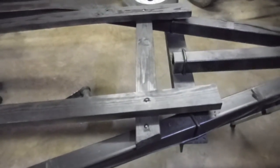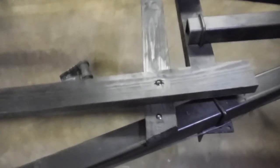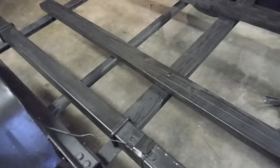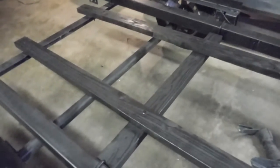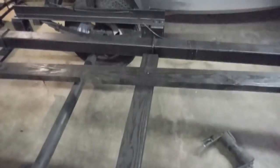What we done is I put a cross board across to raise it up. I drilled through the frame and put lag bolts in the bunk boards. Back here on the middle support I went ahead and put a board across there to raise the bunks up, and also drilled through the boards and put lag bolts in. We got lag bolts in the back too.